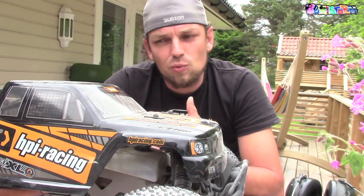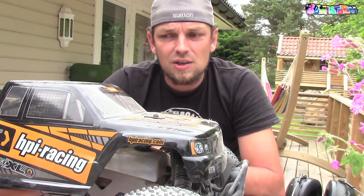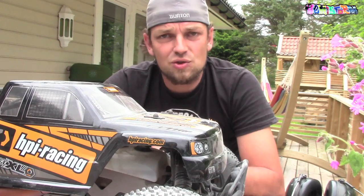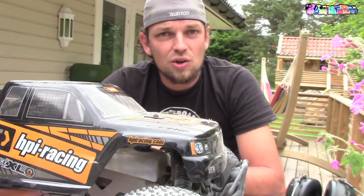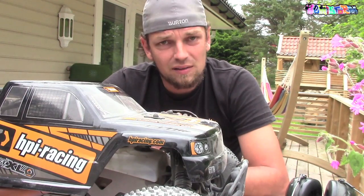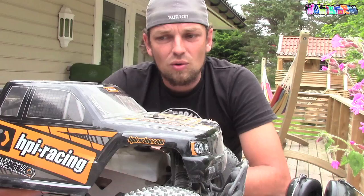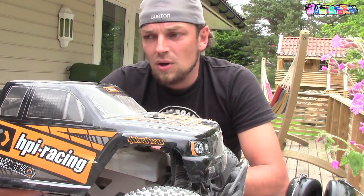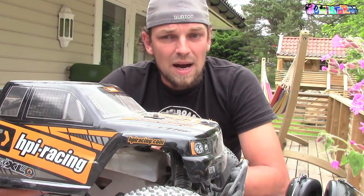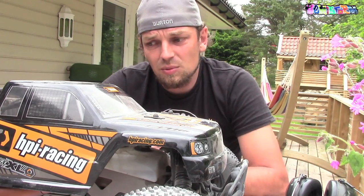On the bigger engines, the 23s and the 26s and so on, it's only the highly tuned engines that need a spark plug change right after break-in. Well, it turns out so does the Octane. You can end up with a gremlin plug that looks like it has a proper spark, and then when you start to run it, or if you want to run it again, it will just give in at random, which was what mine did. Apart from that, also the carb settings take some getting used to.